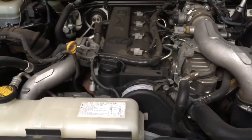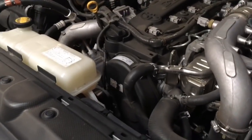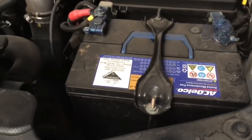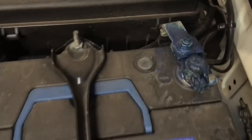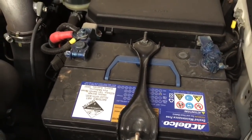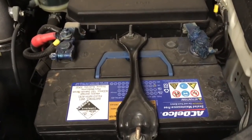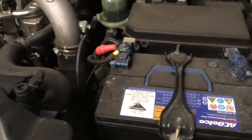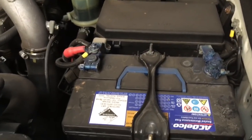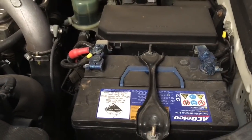No point checking your oil level because you're about to change it — we're talking service work here. Timing belt is due every 150,000 k's. Check your battery, make sure it's secure. You should check the electrolyte level every now and then. The indicator on top is a bit of a gimmick — it can show it's bad when it's good and good when it's bad. Batteries generally won't use too much fluid, and if it needs topping up, top it up evenly across all cells.